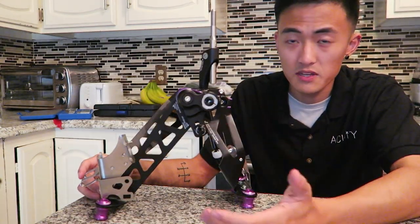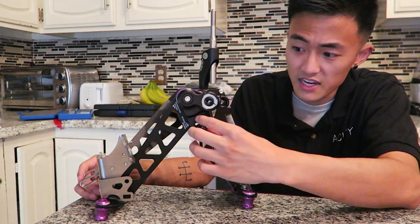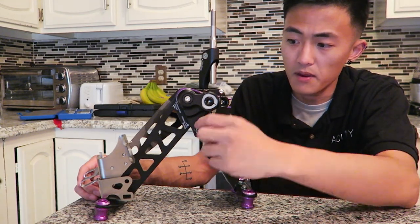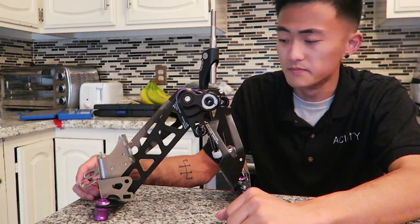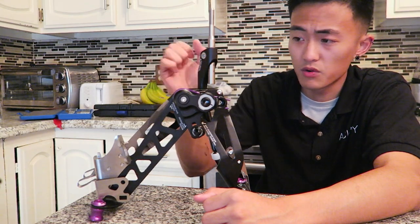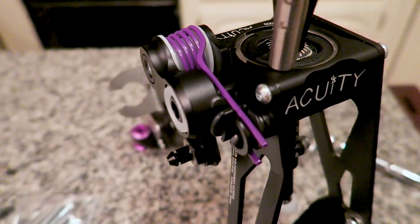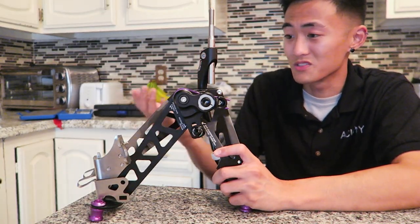Moving on to the final adjustment: if you look at the spot where the actual gate spacing cable connects to the connecting point, it can actually be loosened by a socket. Just like with the throw adjustment, this will allow you to decrease the side-to-side movement of the shifter arm by moving it further down, and if you want it closer to stock, you just simply move it further up. On the topic of the rocker arm, Acuity also provided their upgraded centering spring to stiffen up the side-to-side movement a little bit, and moving this side-to-side I feel absolutely no play, which is astounding.